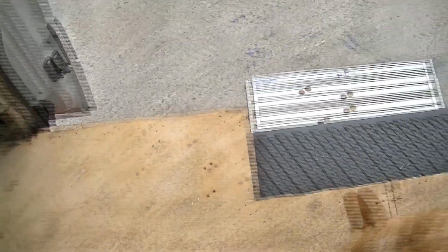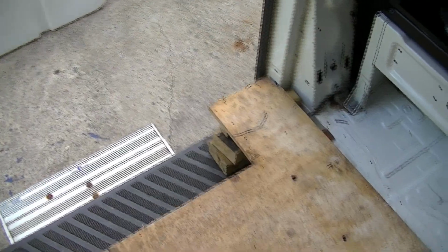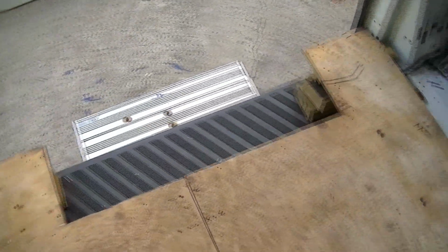That is because I will be trimming that projection to match the kitchen cabinets I build in here. And I may well be cutting that piece off at 45 degrees because I'm toying with the idea of staggering the bulkhead. So I'm not going to be fixing any of these sheets down permanently until I've actually cut them. I suppose I could cut them into place, but there's something else to think about as well.